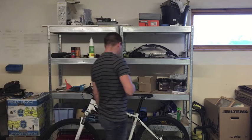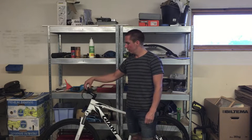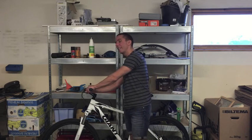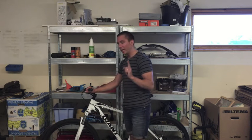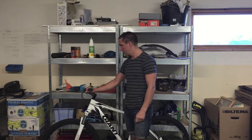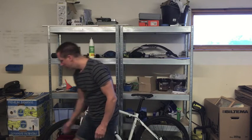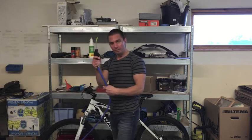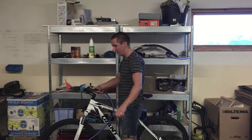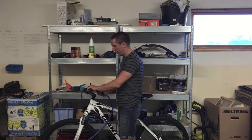I need to do that to be able to remove the shift lever and brake. I had to remove the handle and that's quite tough. But today I got a tip at a local bike shop — they told me if you have compressed air you can put it inside here and easily remove the handle while pushing the air.